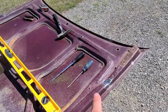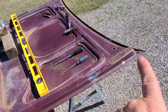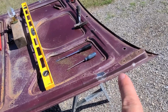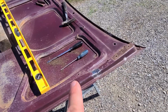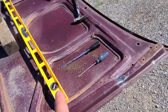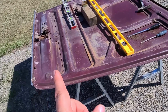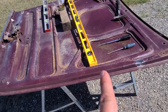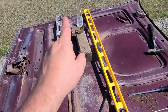Another thing I've done is I've measured this hood six ways from Sunday, from the tip to where you can see this line. I've measured from the holes to the line, the bolt holes to the line, to triangulate the perfect shape here, so I got a nice even triangle. I then took my level here and started at this end of the hood as well, measured back to check the distance between this hole and the little hole right here, and these are identical on both sides.